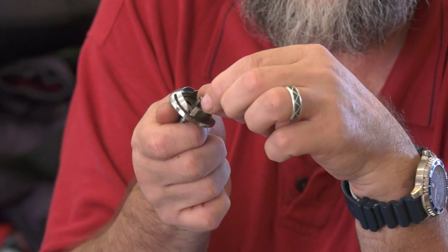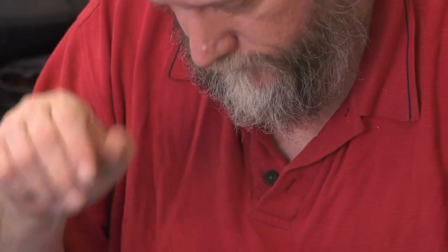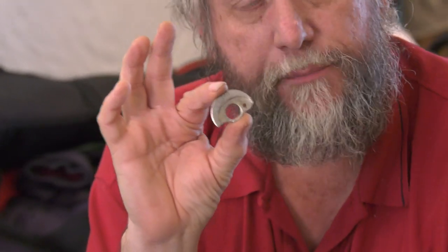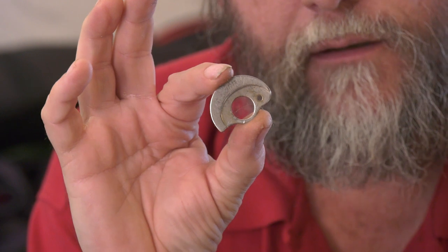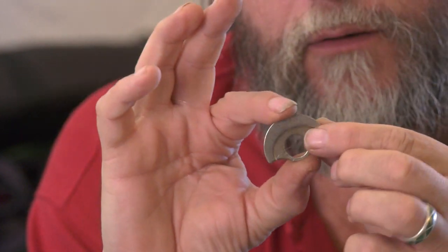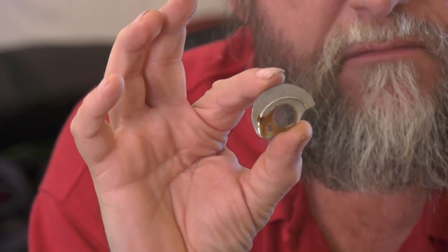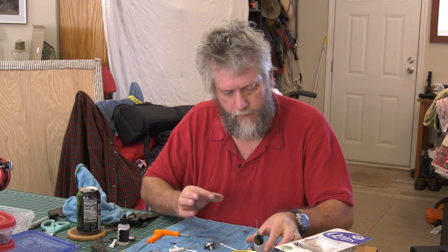And it spins smooth and it's dry too. There might be a little bit of residue. Now, since we're there, let's look at the back plate. That's the last piece we're going to look at, and then we're going to reassemble everything and see what we got. So that's the front. You can see some dust and dirt, grease, varnish. Let's see if we can get rid of it. We're going to use the same process we did before. Little bit of kerosene and toothbrush.